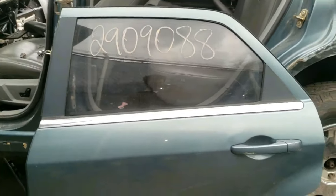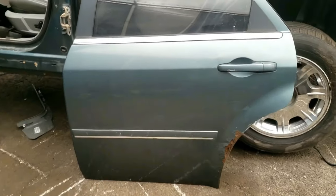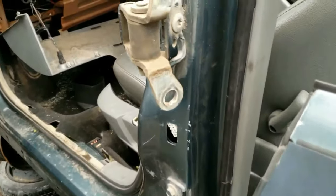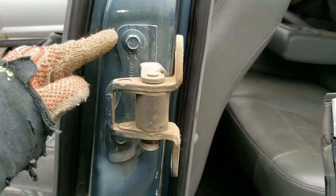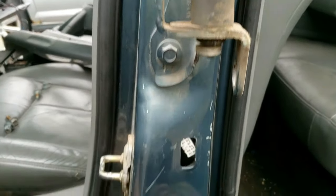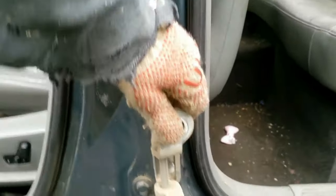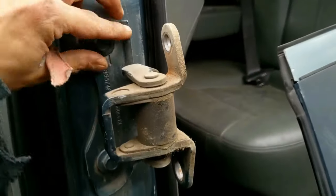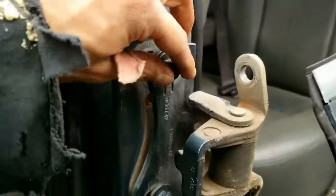This is how the door looks. Next, I'm going to remove the hinges, but if this has helped so far, please like and subscribe. Installing the door is the complete reverse — just remember to torque each bolt or nut to 31 foot-pounds and to reconnect the wire harness connector. When removing the hinges, first trace each hinge with a marker. That way, you'll put the hinge on perfectly when reinstalling later. Use a ratchet with a 13mm socket to remove each bolt. Remember, when reinstalling, to torque the bolts to 21 foot-pounds.